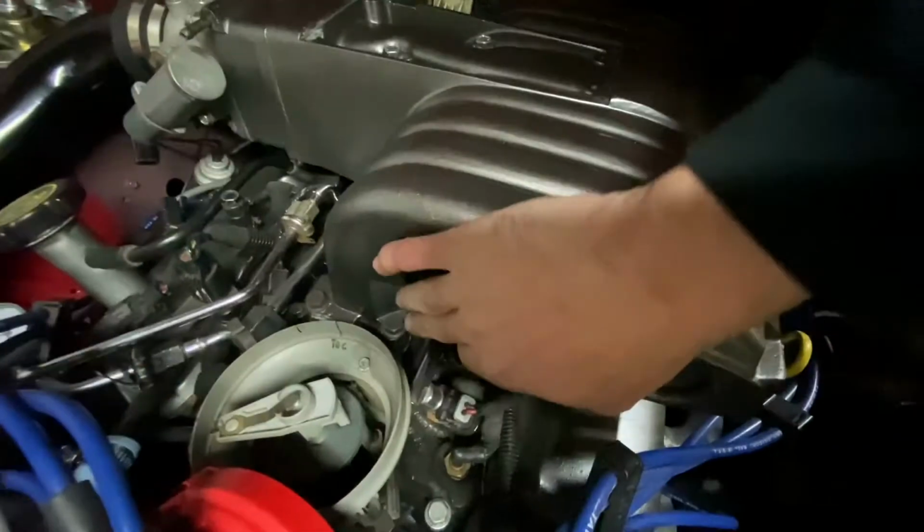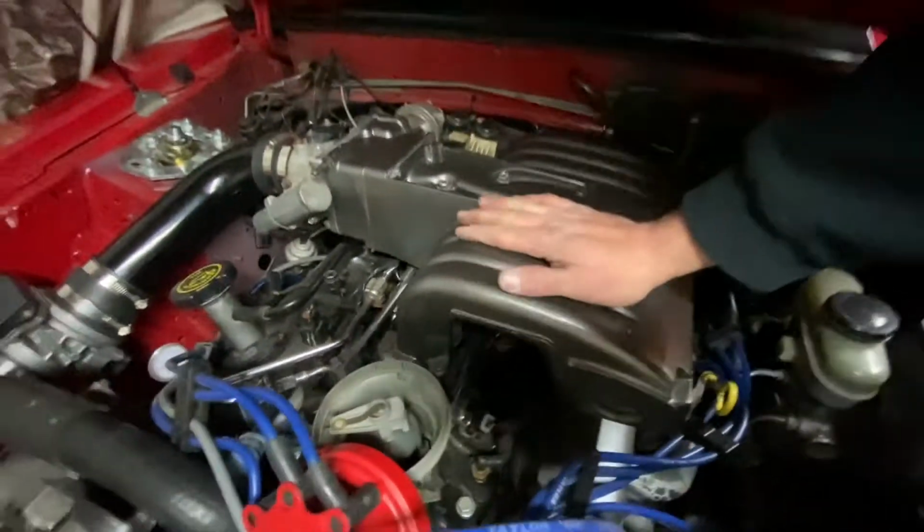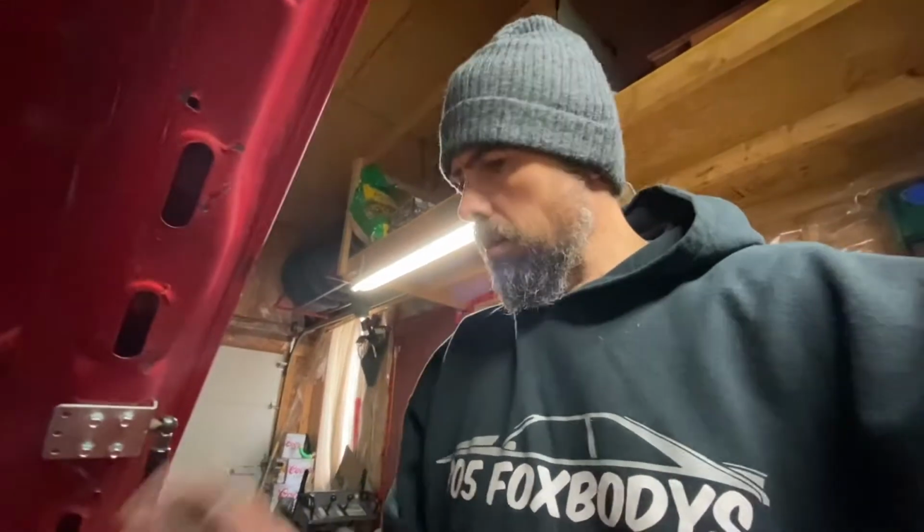So I have all the bolts tightened. I did not torque them. I do snug by hand. Yes, there's torque recommendations. You can look them up. I've always snugged them hand tight. Never had a problem. The lower intake, that's different. I've always torqued those in sequence, because those gaskets are a bit different than the upper intake gasket. So, you know, torque them if you want, don't torque them, but bottom, yes, torque. This one I didn't. I just do it by hand, never had an issue.